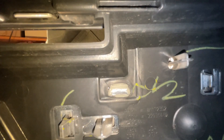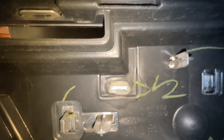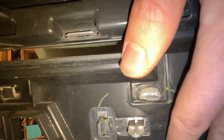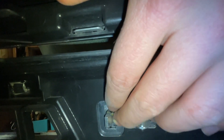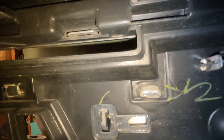I just pushed one back there — it's holding in the badge, and when I originally pulled it out, the angle was very limited. I just pushed one back in to show you: what you want to do is reach your hand down, find each clip. You can see there's one up here, one there, one there, and then the last one holding right here. And you've got the badge out.